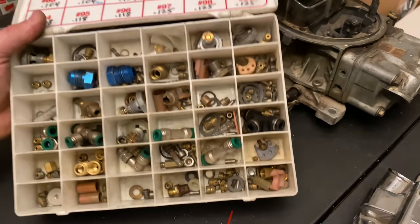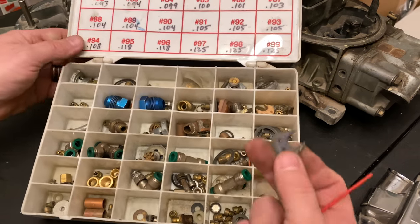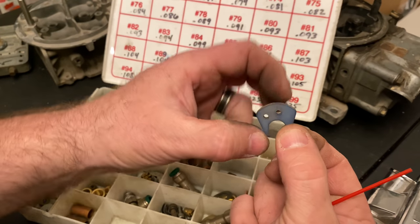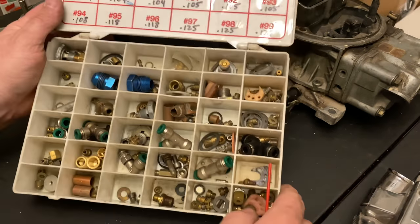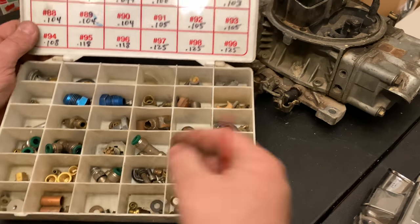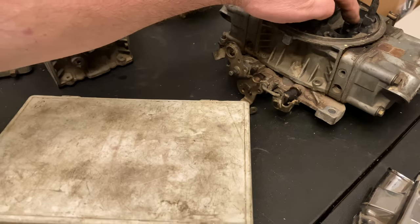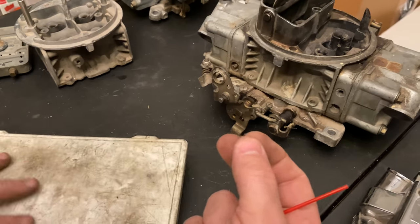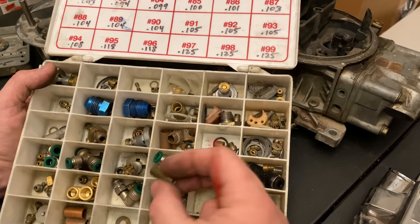I change two in the front and two in the back — that's from years of experimenting. In here somewhere there's also a pump cam I was talking about — it's one of the adjustable ones. You can see the profile: it hits real hard one way and more gradually the other. They're color-coded — there's a pink cam and others. You can buy them pretty cheap. And down in here is that little needle valve — a small check valve under the squirter. If the squirter is off and you press the arm, it'll drop into the motor — ask me how I know.